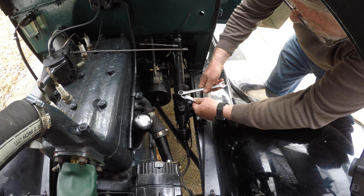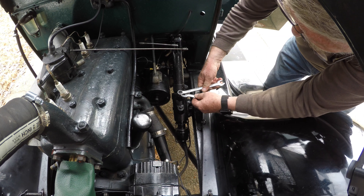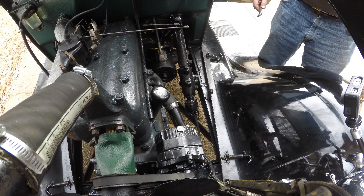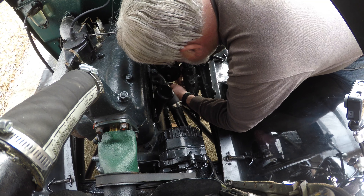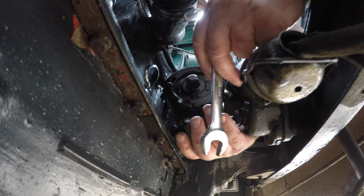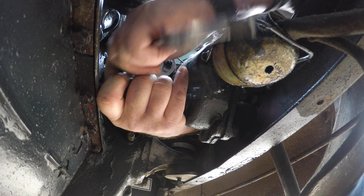Okay, she's bottomed out now. I'll back it off. I'll be tightening that jam nut. So you tighten it down until it feels right? Yeah. In the service bulletin there's no specific torque spec — I don't want to tighten it just dead tight. But I'll back it off a little bit, probably the same procedure where you back it off an eighth or so and then tighten the jam nut down. The service bulletin is, shall we say, unclear. Back when judgment was allowed, I'm sure.